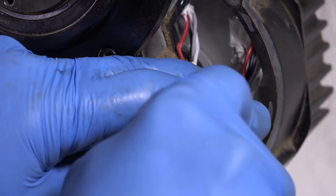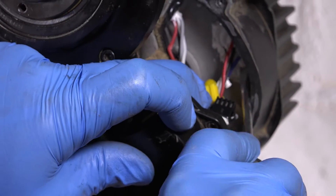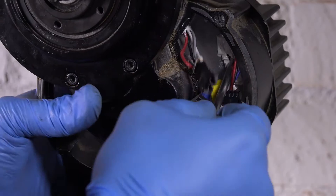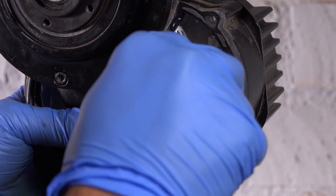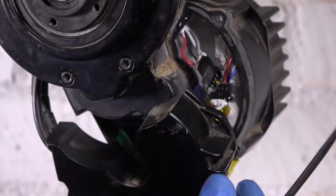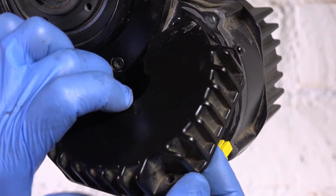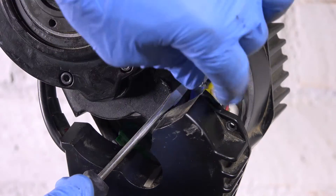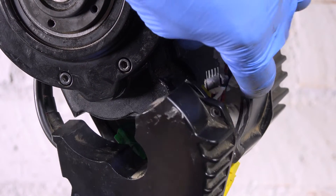You can see there's this one last connector down inside here. You need to get all that silicone loose — just gently pry around it so you've freed up the silicone so it's not holding the connector in place. It has a tab on the bottom side — push on that with the screwdriver while applying a little force on the wires. I'm going in from the bottom with the screwdriver, depress the tab, and lift with the screwdriver as I pull on the wires.